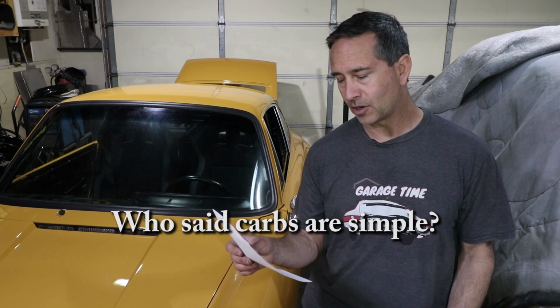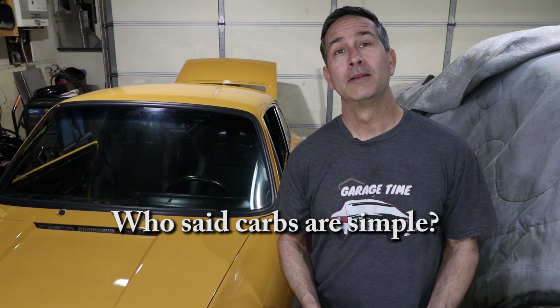Also, all the fundamentals, like there's so many things on the carburetors. There's the fuel pressure, the float level, the carb synchronization, the air bypass screws, the venturi chokes, the idle jet, the idle speed screws, the mixture screws, the air correction jets, the main jets, the emulsion tubes, and the accelerator pump. So I played with all of those things, and I'm going to share my results with you. Hopefully your engines can run well too.